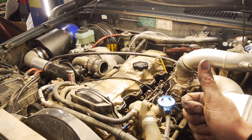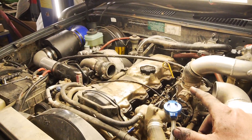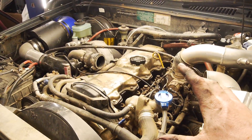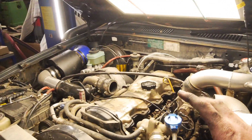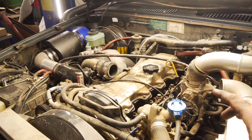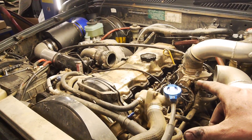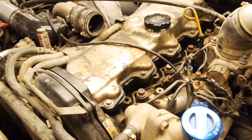One of the reasons why I'm doing the glow plugs is firstly because I don't know how old they are — they're cheap to do. The main reason is it's a bit hard to start on cold mornings. So I thought first step, I'll pull the glow plugs out, and while they're out, I'll do a compression test to make sure that I haven't melted or cracked a piston. Obviously a leak down test would further confirm that, but I don't have the leak down tester here. I can safely say the engine's healthy. So I'm thinking it's a leaky injector or a bad spray pattern or something — that's the next point of call.